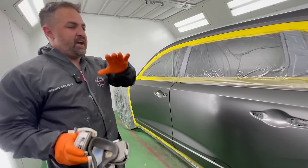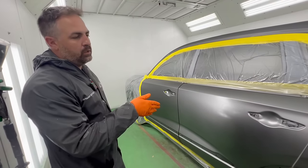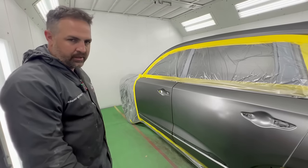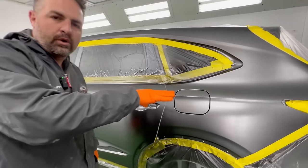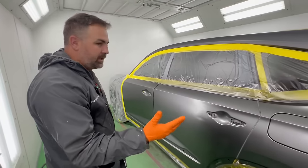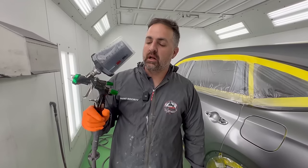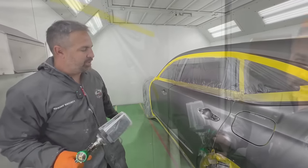All right. The effectiveness of pre-painting the door has gotten us to the point that in one coat, it's covered. On the next coat, I blend and I'm done. So no sand piling on the door edges, no sand piling on the quarter panel. This thing looks completely smooth, but you cannot overpower this gun with pressure and overpower it with a big fan. Close the fan down, open up the fluid, get your pressure around 19, 20, 21 seems to be working right now for me. Let's let this flash and see what it does.